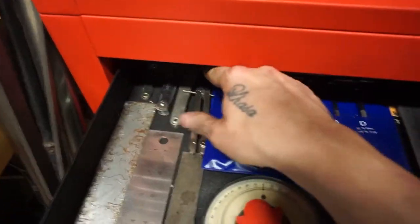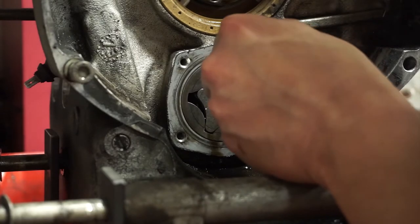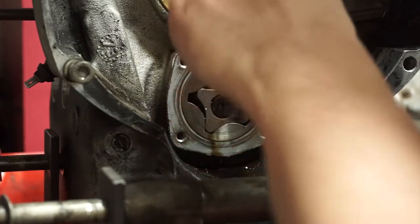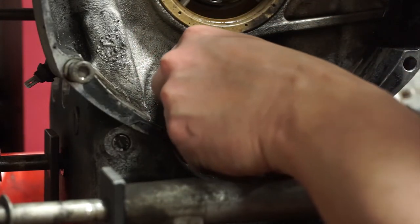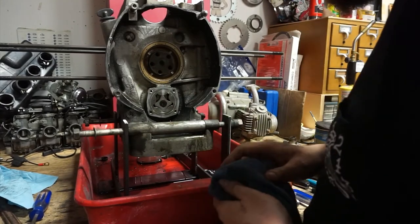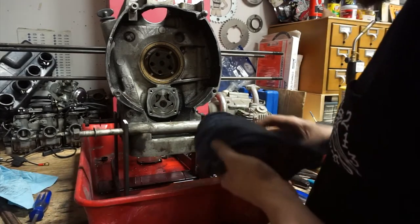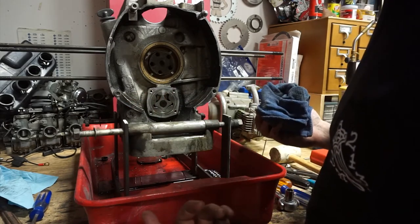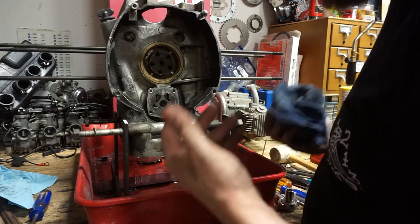to measure our pump. And so we need some feeler gauges. These will do. Give it a shot. Yeah, already we're oversized. That shouldn't fit in there. Unsurprisingly, this oil pump doesn't really measure out that well, so I'm thinking that could have something to do with why the bearings are in the condition that they are, why the lifters look like they do.